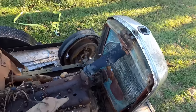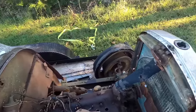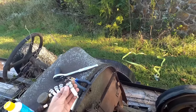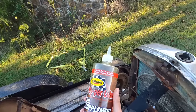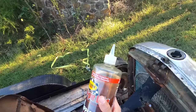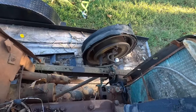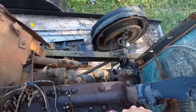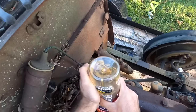She's been sitting for another couple hours. I've spun her over three or four hundred more times while she's been sitting, with one valve open and one valve closed to start loosening things up. The coil is going to be shot, so we'll put some MSD coil on it. We got a set of four spark plugs to put in, and we're going to pour some Hyper Lube down in there — that thick type of oil gets around the rings, helps build compression, and keeps the cylinder walls from getting eaten when you first start them up. She will smoke like a freight train when we first start her up.